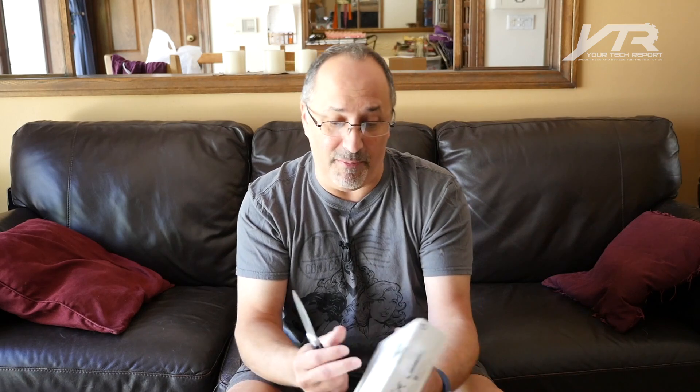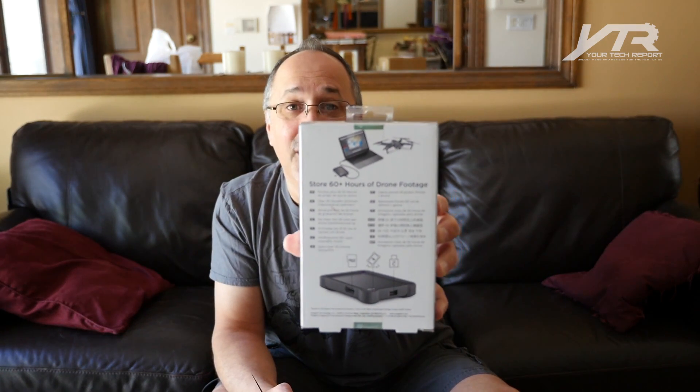So what do you say we unbox this sucker and talk about what this drive is and who it's actually made for? Old man glasses on, unboxing knife in hand. The first thing you notice is this is a 2TB USB-C drive. Now a lot of you might not know this: USB-C isn't necessarily the speed — USB-C is the shape of the connector. The speed can either be Thunderbolt, USB 3.0, or 2.0. I can't find where it actually says what speed this is, but the transfer rates are very fast, so I'm going to assume it is a Thunderbolt 3 drive and I'll follow up with more information on that later. It says on the box: store 60 hours of drone footage, and that's actually based on 4K video at 30 frames per second. To get 60 hours of that kind of video, that's really good — especially if you shoot in 4K, you know that is a lot of storage.